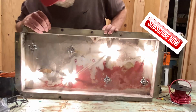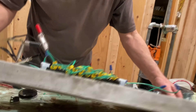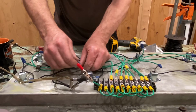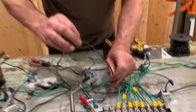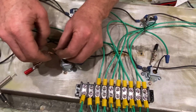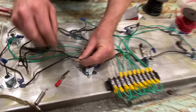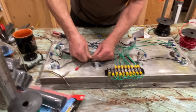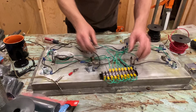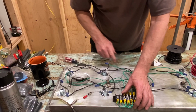That's pretty bright. What's that doing? Oh, you're stepping on the pedal? Yeah. That's a lot better connection than it was yesterday. Yeah. So it's just troubleshooting now. This one didn't come on, did it? No. Could be a bad ground. It was a few of them. I know it was this one. Yeah, one of them was that. It was this one. They have to be grounded. That's for damn sure. I'm just going to make that a ground. Make these all hot from on down that way. So, undo this.